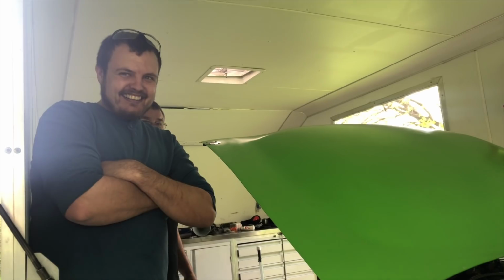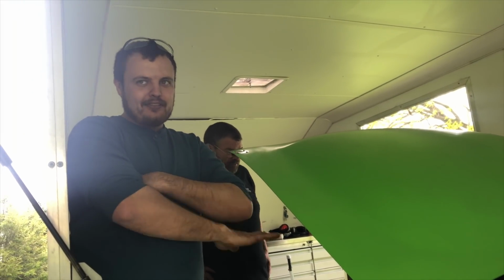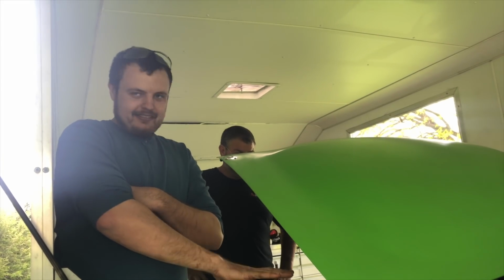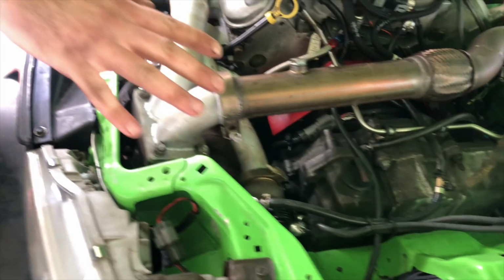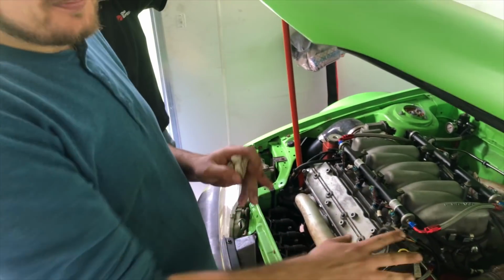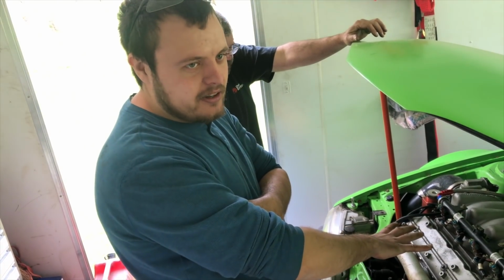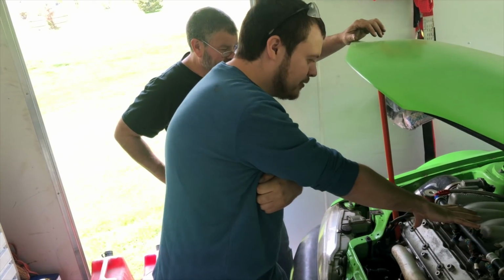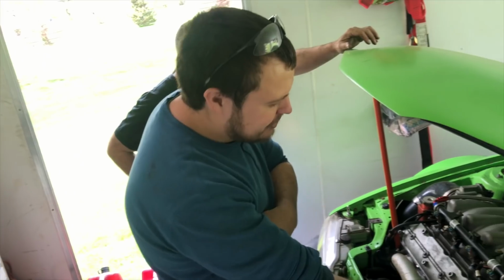I hear that's like the fusible link of pretty much all this, yeah. The 4T65E that they came with, they're made of glass. This is the 4T80E, which they only put behind the Northstar engines. So they put this garbage engine in front of a super stout transmission that regularly fails at 100,000 miles, and then they put this engine that's capable of taking lots and lots of horsepower in front of a transmission that's made of glass.